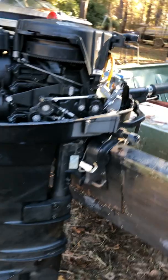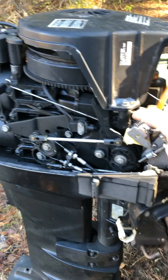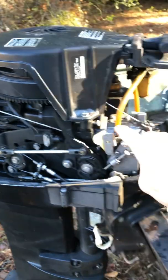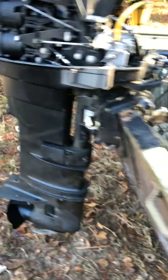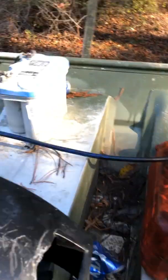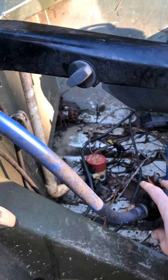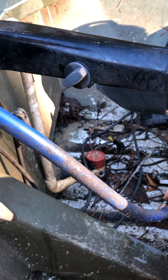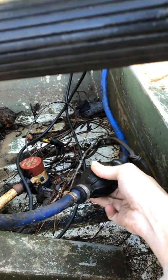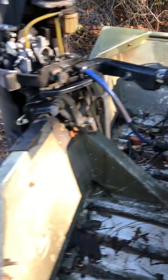Let me give you a look at this motor. What I've had is it'll crank right up, then it'll die. If it dies it doesn't want to crank again — you gotta come in, gas it up a little bit, get it going. I thought we got a fuel problem, maybe it's in the tank. I talked to a buddy, said make sure you go get this good blue line. It already had that on there. The bulb I thought was already working good, but I went and changed it, made sure the lines were clean — bulb stays hard.